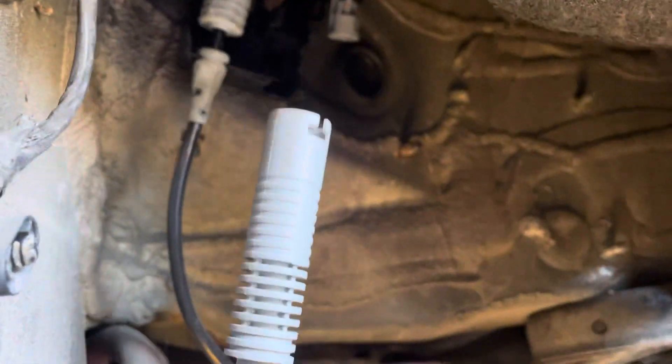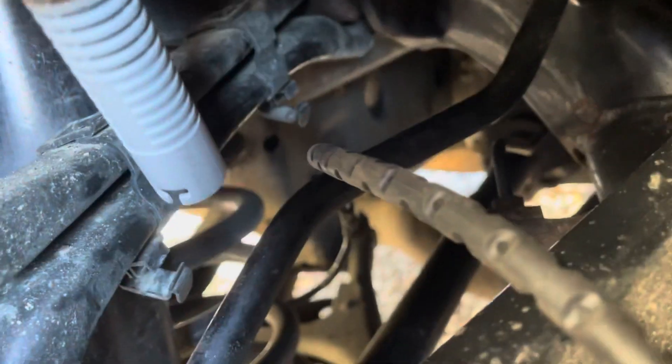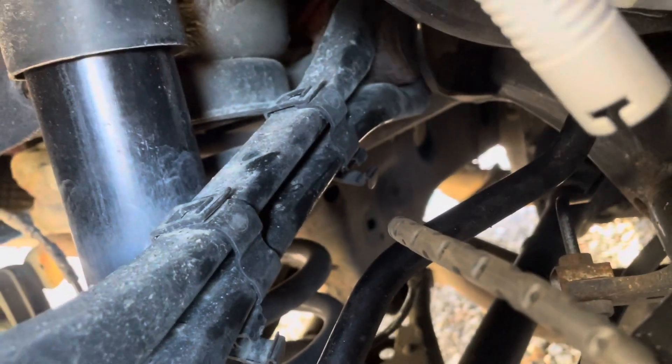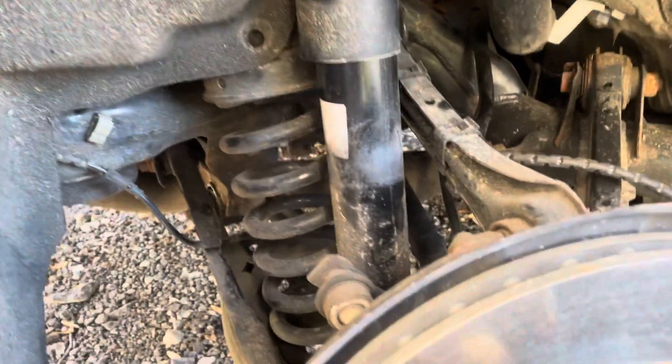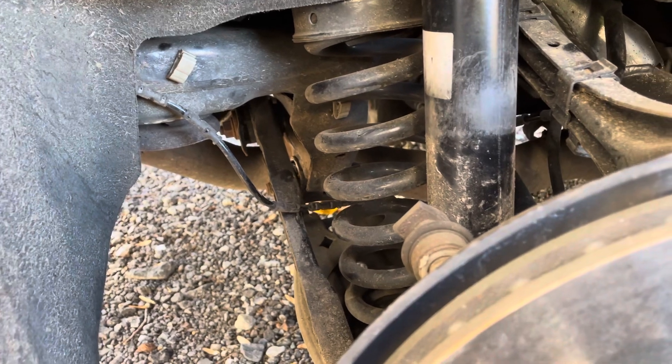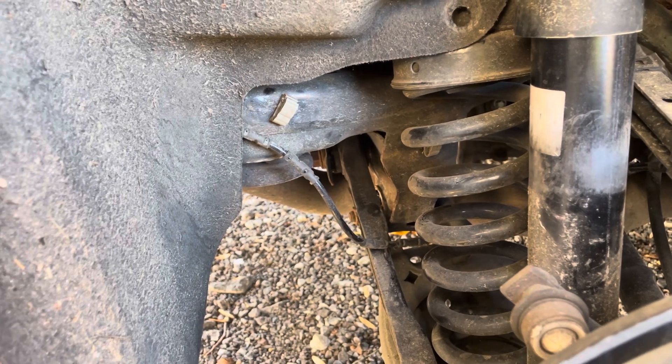To put it back in, it's just a reverse. You're going to first connect it there, then wire it through all the clips — the one in the back and the one in the front. You're first going to put the wheel speed sensor wire in, and then put the ABS wire right over it, and then re-clip it. Hopefully that helped — I didn't see any really good videos on how to replace the speed sensor, at least the rear one on the E90, so I figured I'd put together a video. If you found this useful, please give it a thumbs up and consider subscribing. Thank you so much.